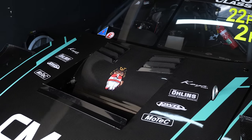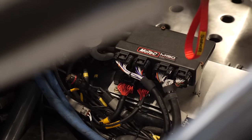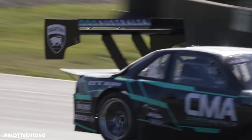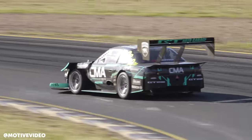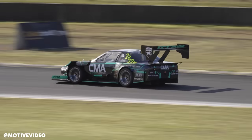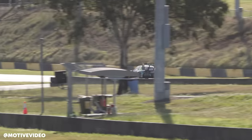Can you give us a high-level overview of what the GPR Pro package allows in terms of torque management? It allows basically everything. From second gear low stuff, you can give it 500 Nm at 2000 RPM or you can up it to 1000 Nm wherever you need it. It also incorporates a tyre friction model, and there's a heap of driver aids and car aids to really support everything. We've got a couple of videos on that GPR Pro, the torque-based model and the traction model, so we'll link to those as well.